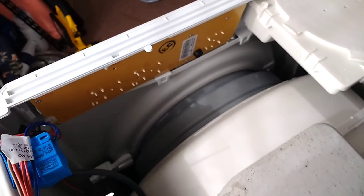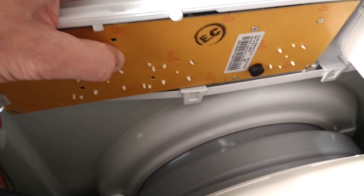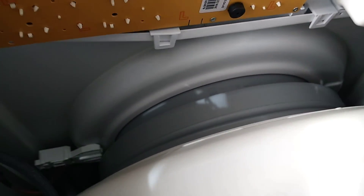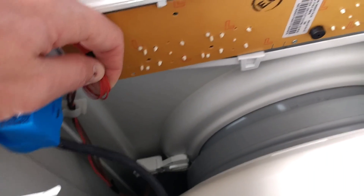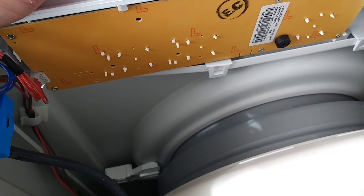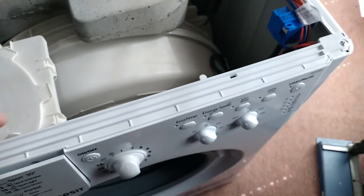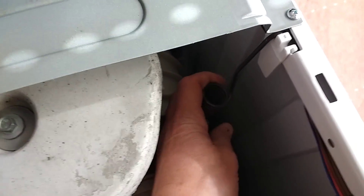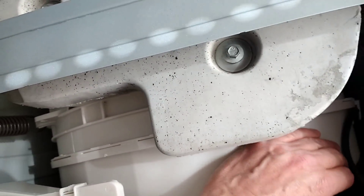At the back, the front control panel is just a very cheap phenolic type circuit board. It's got five connections on it — just five wires. I would normally expect power and data, maybe four wires, but I wonder why they've got another one. Maybe it's got a wake-up function that uses an extra connection. It's got the suspension springs here, giving some basic suspension.